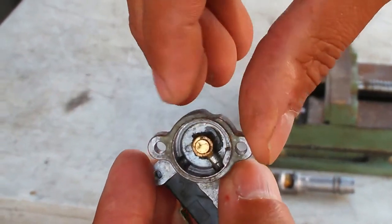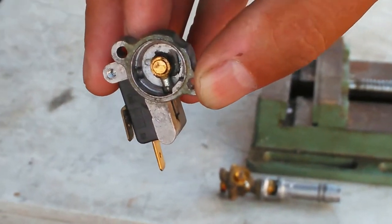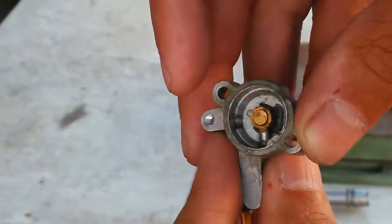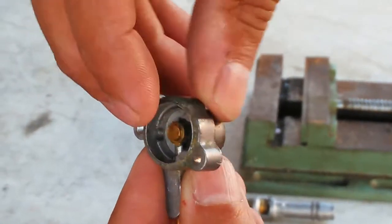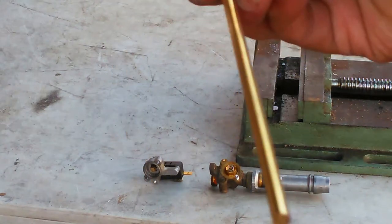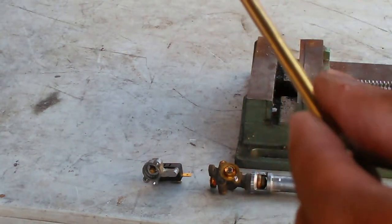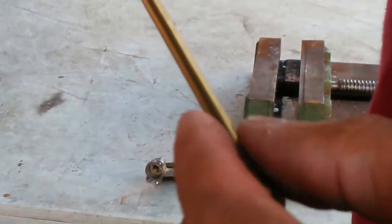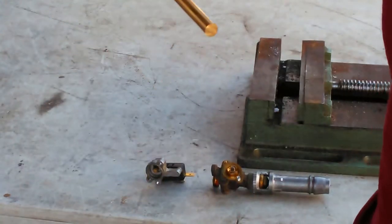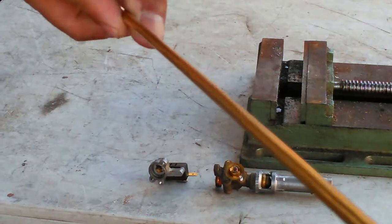The rod is actually fit into a sleeve — it's actually a rod fitting into a hollow tube, very tight tolerance, so I'm going to have to measure that. This size diameter is bigger than this size, so I'm guessing it's a piece of rod. I got a piece of rod to do this with — it has to be brass. There's a certain technique to building stoves that dictates that anything that touches gas is going to be brass, because brass is less susceptible to oxidation and corrosion — gas tends to corrode any other metal, lead, steel. So they use brass for the pieces.